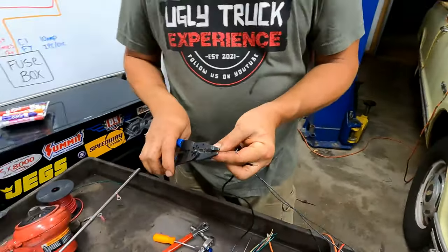Cool. And it says that it's position F7 in connector 1, which is the white one. So what we got to do is go to that connector number 1 and add a wire into F7. And hopefully when you took all this stuff apart, you saved a bunch of those wires.